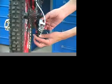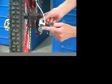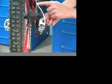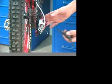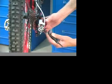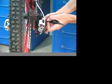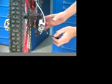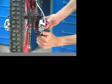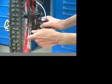Inspect derailleur for alignment and check for worn pivots. Replace derailleur as necessary. Inspect inner cable and housing for adequate length, cuts, and fraying. Check security of all derailleur system fasteners. This includes hanger bolts, derailleur mounting bolts, cable pinch bolts, and both the lower pulley bolt and upper pulley bolt tightness.